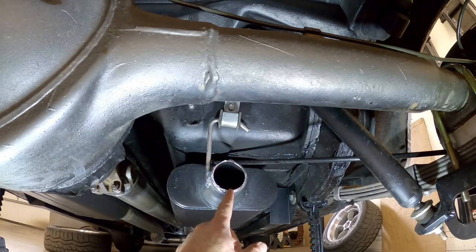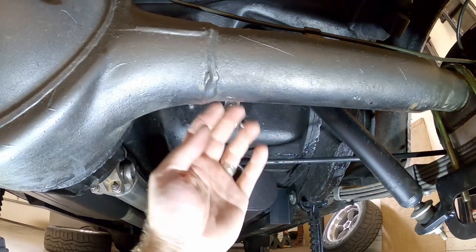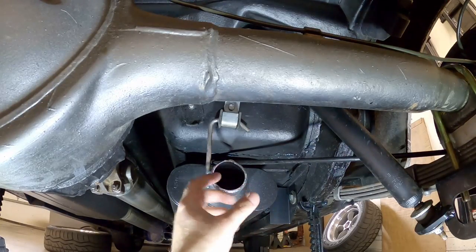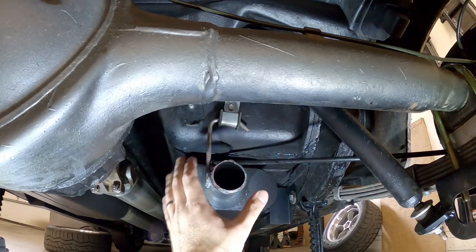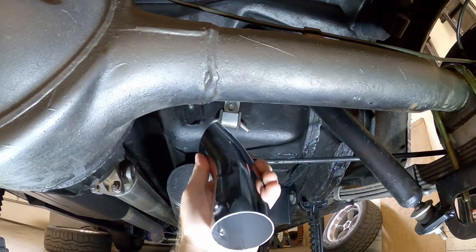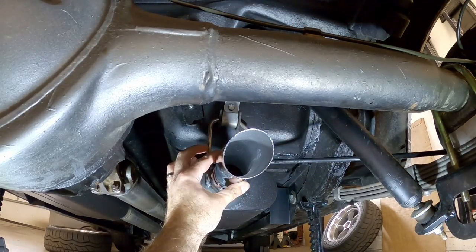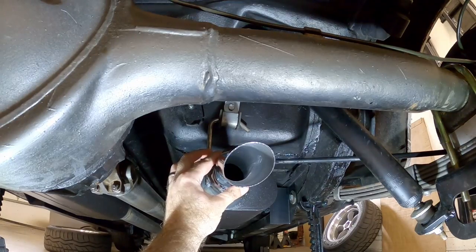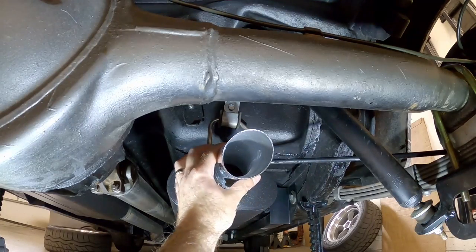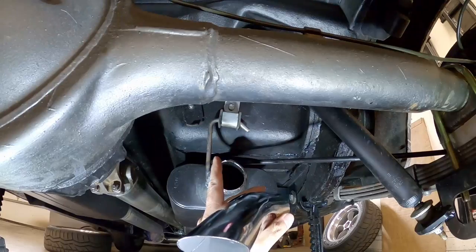You may be wondering what to do with the exhaust now that we had to cut it off. I don't really want it hitting the axle, so my options are to get to the muffler shop and have them fix it so it fits with my whole suspension setup. In the meantime I've got some generic exhaust tips I'm going to tack in place — put a couple tacks on it angled down a little bit. It's going to be louder than my normal exhaust but it's just temporary to get me to the muffler shop.